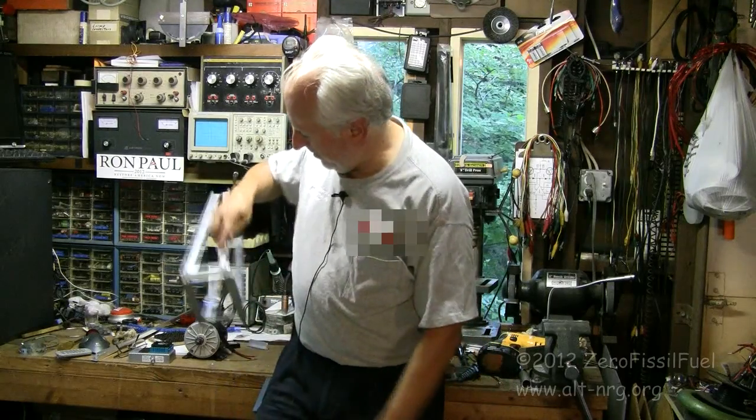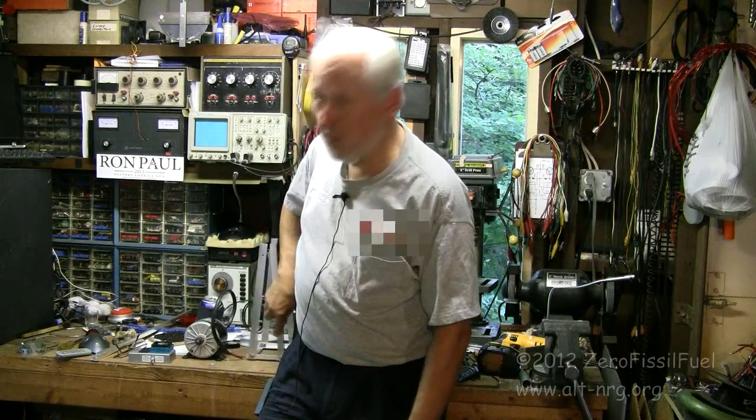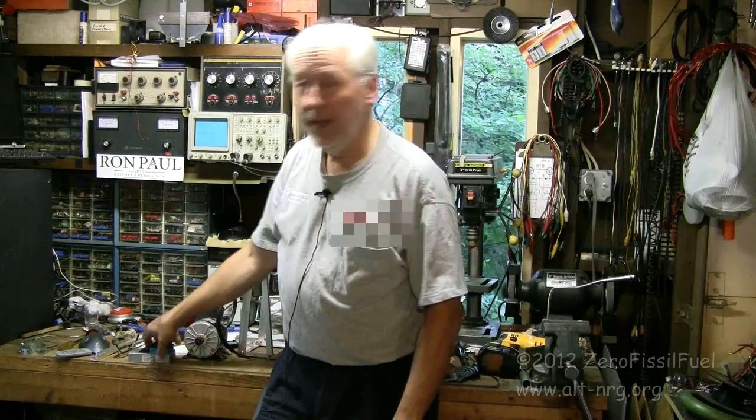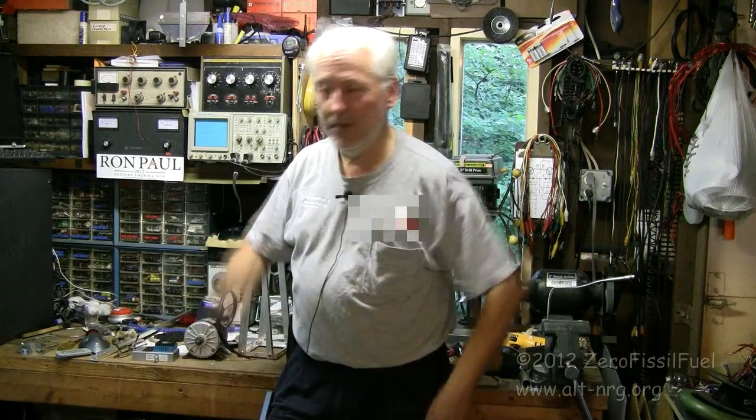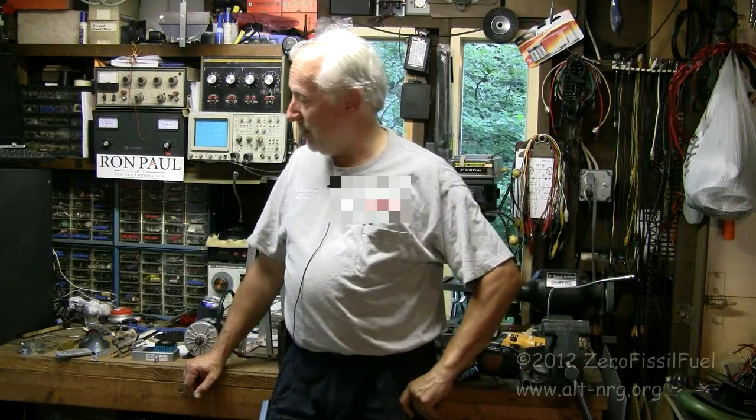The bike is right here to my left and I've been doing some measurement and continuing the work on that. I will be using my famous constant current pulse width modulator as the motor controller, which will prevent an overcurrent condition from being supplied to the motor. I may even try running this 36 volt motor from a 48 volt power source, since I can limit the power going to the motor with the current limiter on the pulse width modulator. That turns out to be a very unique feature that may come in very handy in this application.